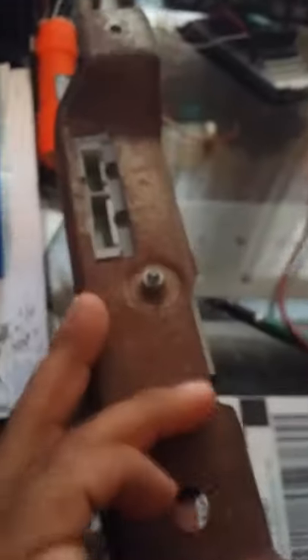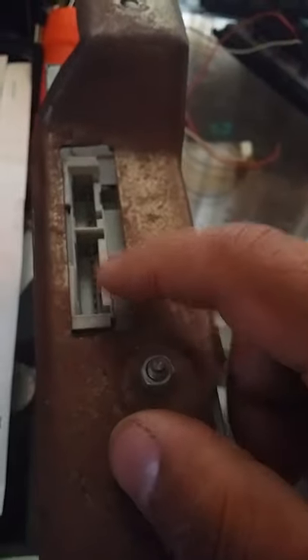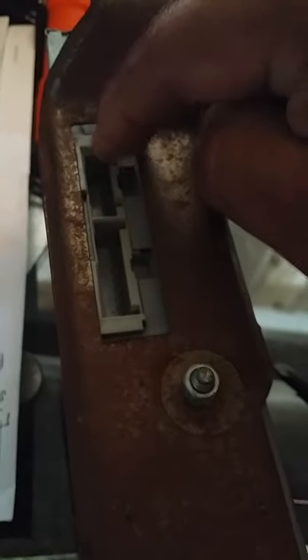On the flip side of the CDM, that goes to your control head and your cassette deck. On the cassette deck — I was playing with this one — I figured out how to trip it on, but then the motor runs all the time and I don't want to put all those extra hours on my cassette deck or just sit there running tape for no reason. So I figured out what pins do what on the cassette deck connection. Pin 1 starts over here — that's where your head unit control plugs in.